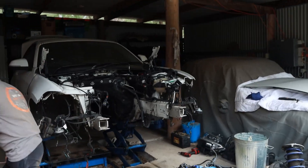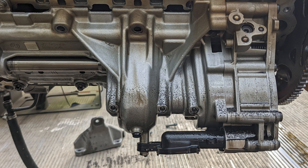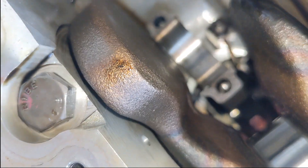Let's not lose that bolt. As you can see here, unfortunately we couldn't get any good video shots of this. But you can clearly see there's quite a lot of crud around the base of the oil pump — a lot of carbon and crap essentially. As we'll later find out, the con rod had twisted in a way that it actually forced it to crack the wrist pin out of the piston, and that's what caused the piston to fail. And then as a result, it was just leaking combustion straight into the crankcase. I can't actually take this cylinder out at the moment — just don't have the tools on me.